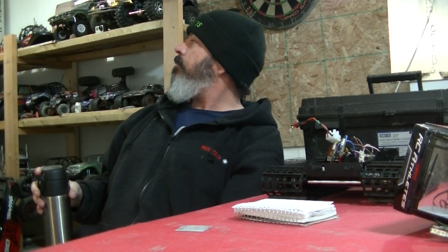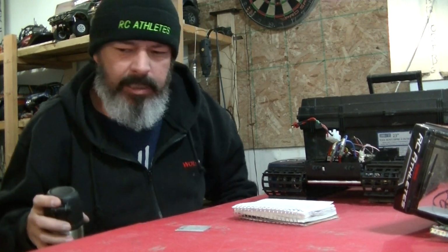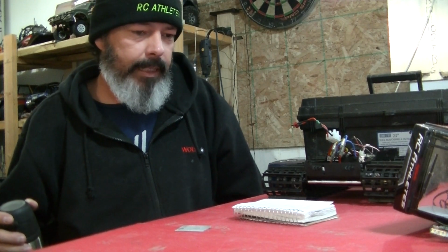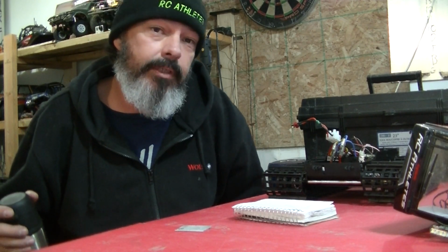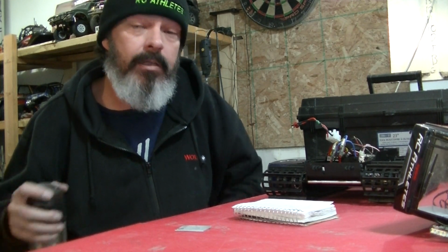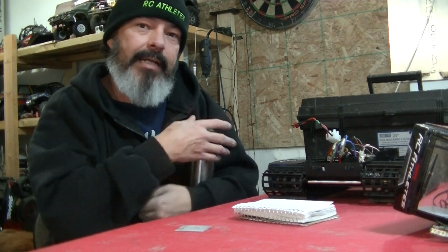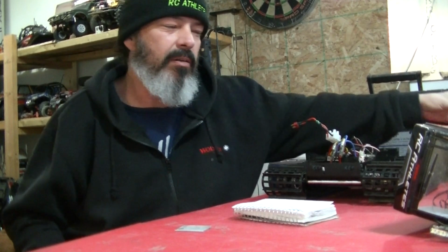I have a FlySky GT3B, I think it is, and it's been hacked by Rookie. I don't know if he still does it for people in town. I think so. Charge you a case of beer or something like that if you know the guy. And then he can make the GT or the FlySky radio mix. And there are other ones out there now that are cheaper than back in the day that'll do mixing. But you need a radio that mixes, or you're stuck with the sticks, because you can control one ESC with one thumb. And it's really harder to film unless you attach the camera to the front of the radio, which is a big pain in the ass for me. I tried it before. I don't like it at all.